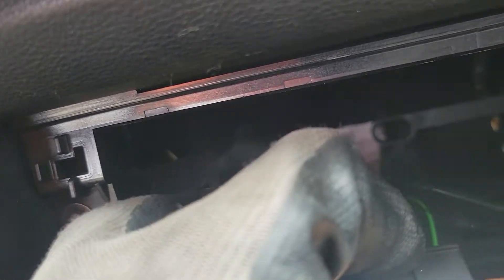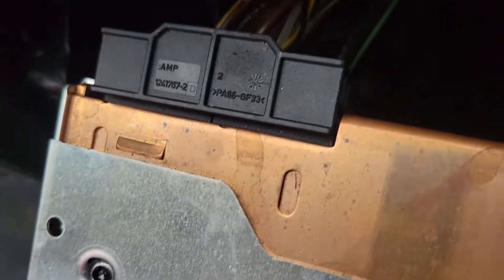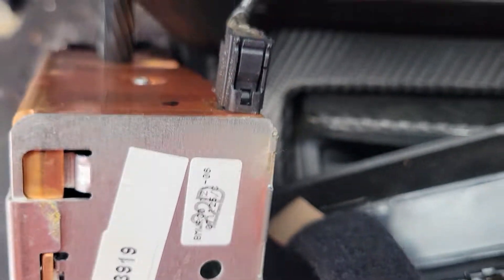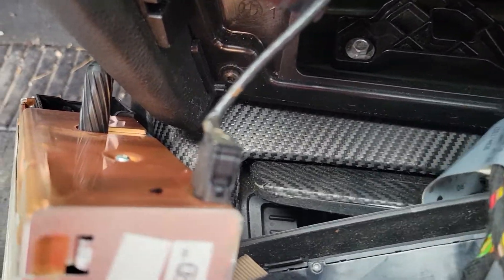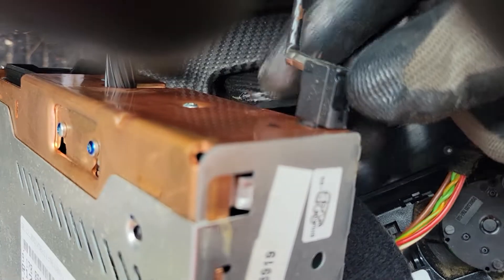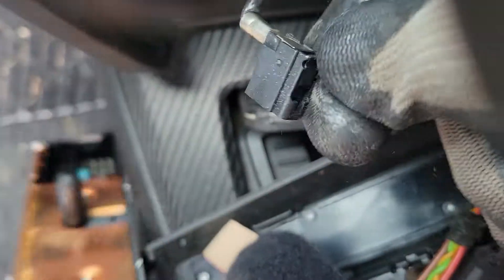In order to remove the plug, you have to get underneath here, turn it just a little, pop it loose, then push it away and the plug will come out. For your radio antenna, you've got just the slightest little tab — press on that. It's really hard to do with one hand, but that's how it releases.